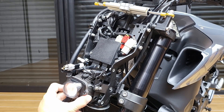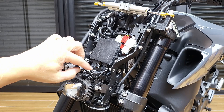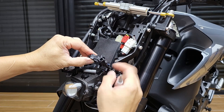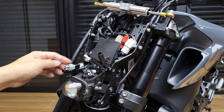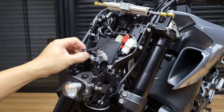This is for guys who are upgrading the projector from the stock projectors. To start, remove the full front face cover completely and then take out the sockets. Remove all the sockets from the top. We can go ahead and remove this plug. This is the power, the DRLs — this is the stock harness — remove all the plugs from here. The connectors, the clip-on connectors.